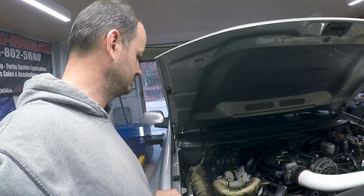Any other time I'd have a whole bunch here, but right now I don't. Yeah, I can't find this Mac valve style solenoid anywhere. Guess I'm all out. So Kayvon's gonna try and grab one from Matt. He thinks he has one. Drop it off tonight. I'll throw it on tomorrow, turn the boost up a few pounds on 93, and then we'll pour some E85 in it, turn it up a little bit more.